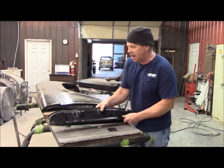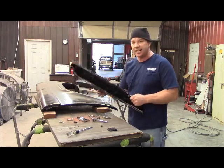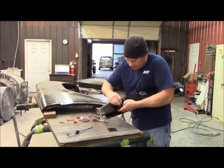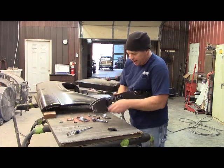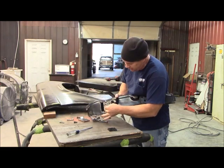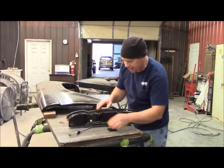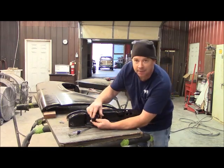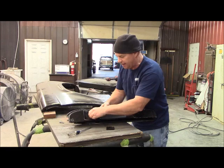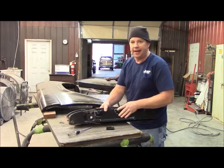I pulled the post off the side of the Bronco — this is just an aftermarket piece. As I started studying it, I noticed the adjuster for the front hinge: the top of the plate back there is too large, so this won't even adjust up — it'll just barely move before it hits. So I'm going to pull those out, grind the top of that plate and clean it up. I've already done one so it now has full adjustment. I'm going to do this one the same way — get full adjustment, put it in the center of its spot, then put it back on and see what we've got.